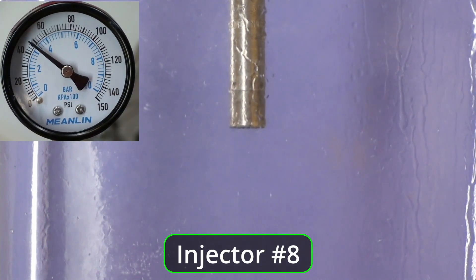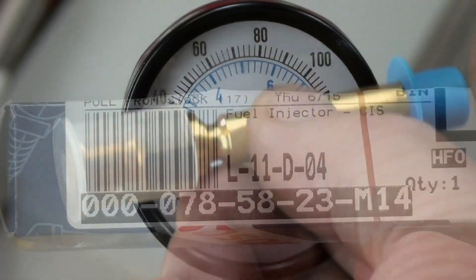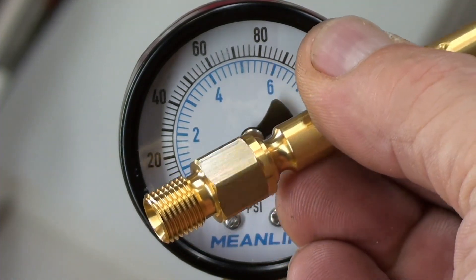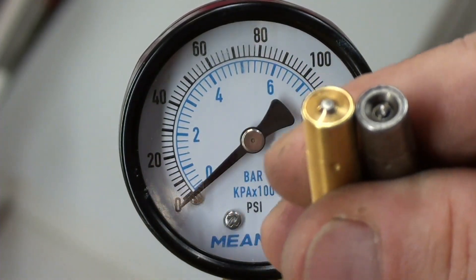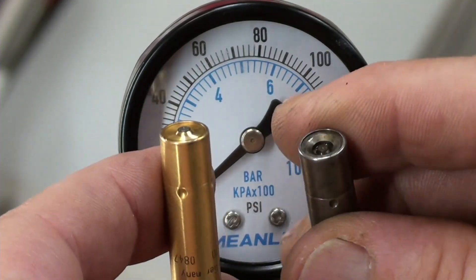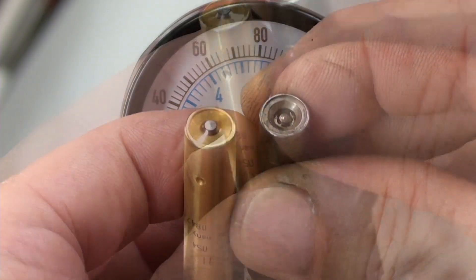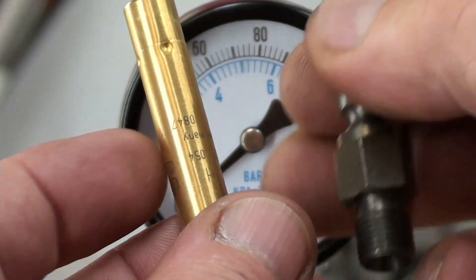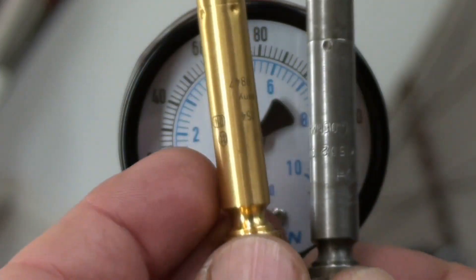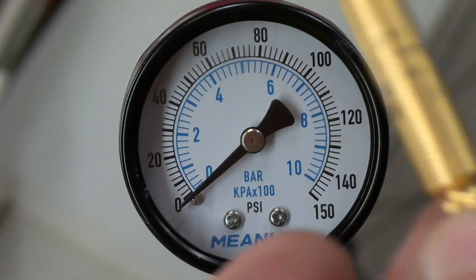Now let's test it with a brand new one. That's the Bosch injector that I purchased — just one, that's how it came. There is a difference. Do you see the type of head that this one has? This one here is like inside, and this one here is outside — it's a different part number, but it referenced to this new part number. So they gave me the right injector. Look at the color too — brass injectors versus these steel kind.